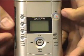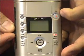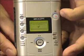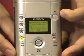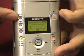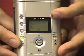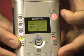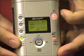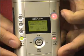Using the H4 is quite easy. It takes about 7 seconds to power the unit from dead start and boot into the operating system. Once the OS is loaded, the LCD screen will tell you the name of the file it will record, as well as the total remaining time left on the memory card. Recording is as simple as selecting the recording mode that you desire — in this case I've selected MP3 — and then pressing the record button. The first time you press the record button, the LCD will display live sound levels from the internal microphone or external ports, so that you can select the appropriate gain to keep your sound levels from distorting.